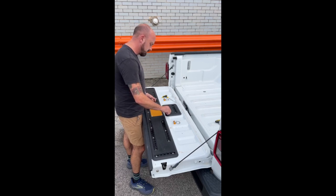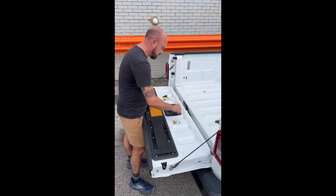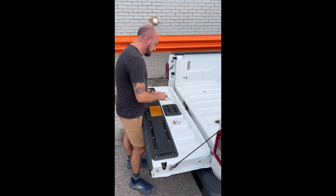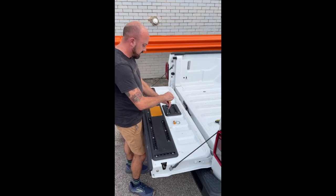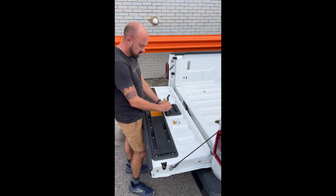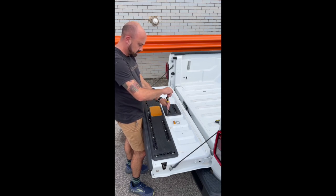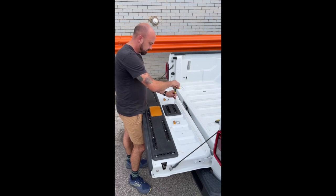Wrapping this up, maybe you even started with the outpost, but we're gonna do something here. Just gonna show you again. We start with our fingers. These are M6s. Jeep, Ram, they all spec these M6s, so we've obviously mirrored that. We see these cross-threaded from the factory. If yours were cross-threaded, tap them out, clean them up. If you don't know how to do that, call your buddy. Oh no. Run these down. Again, snug, little blue Loctite.